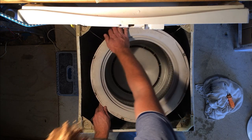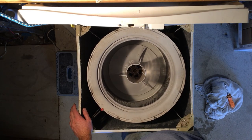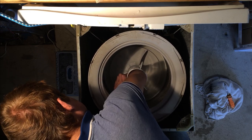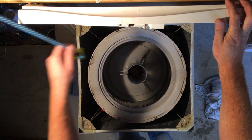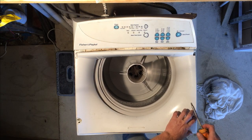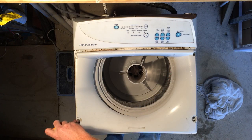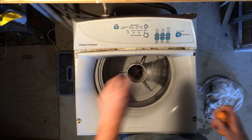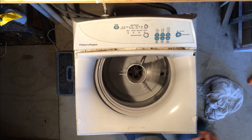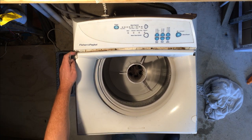That notch is in the left front corner. Agitator slides down on the spline. Agitator nut — or bolt, depending on which model you've got. Spring's on there. This sits down — you might just need to push those clips at the back to clip them in properly. Screw. Screw. Put that one in straight. Lid — just need to make sure those tabs are both pointing up.